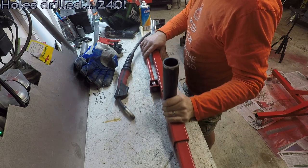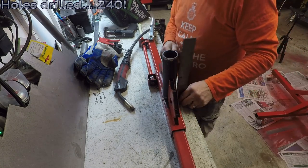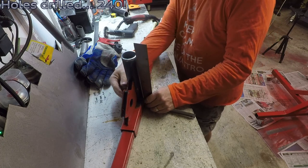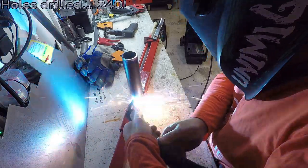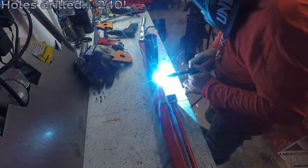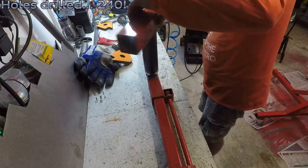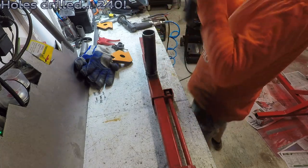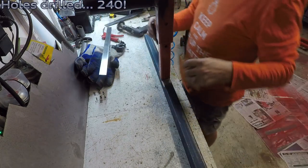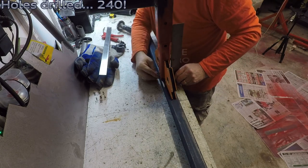Now attaching the inner pipe — the smaller pipe — to the adjustment sections. Again, needs to be as clean as possible; I don't want it wobbling and going all over the place. By this time the welding sunburn had started, so I put my safety welding top on. A little bit of a test of the inner and outer pivot points — they seem to fit pretty well. This bar basically will go across the front and back of the car, then I'll fabricate some pickup points to the underside of the car back onto the subframe mounts.